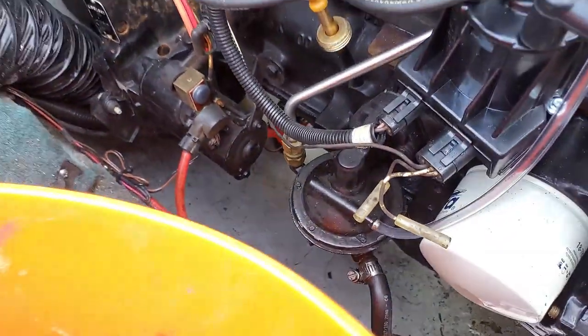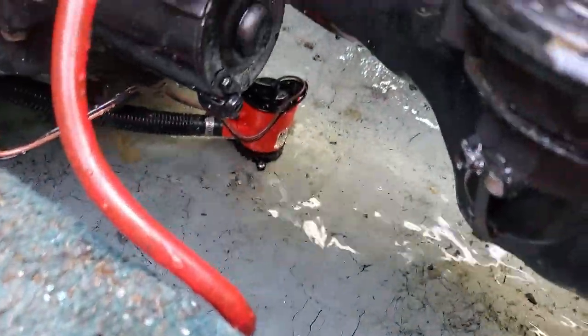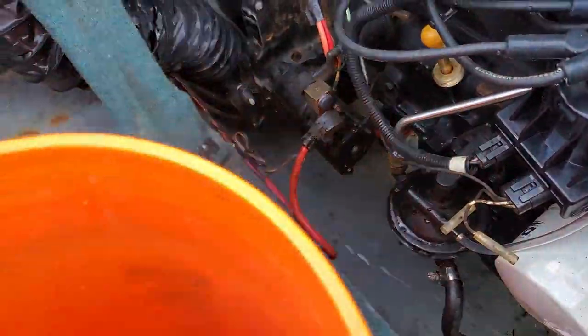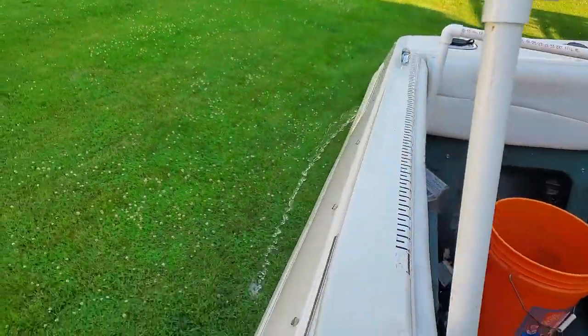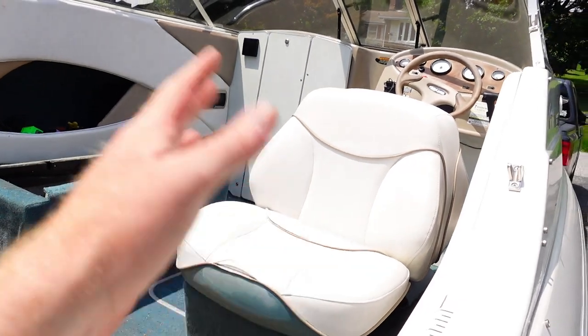Now we're actually going to do a water test. Fill up the bilge and put the plug in. We've got some water down there — I want to check if my hose is dry rotted, make sure there's no leaks, make sure it doesn't need to be replaced. It's coming out and I don't see any leaks inside the boat — all systems working. The trailer lights still work, I put the plug in, and I cleaned up and repaired one of the pairs of seats so I had something to sit on while running under load. Let's go throw this thing in the water, make sure it floats, runs under load, and if all that checks out the next video will be me ripping out the floor.